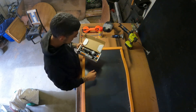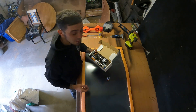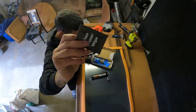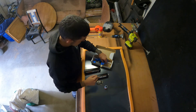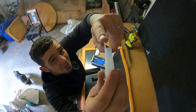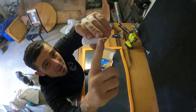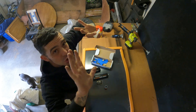A bonding kit. Now this window kit comes from Van Pimps as you'll see they're branded on there. I'm not paid or endorsed by them, it's just who we use and who we've got a trade account with. You've got your sealant, your glass wipes for prepping the surface, the primer that we apply to the glass, the applicator for the primer, some rubber gloves which I never use and always get it all over my hands, and the nozzle. You'll notice here that the nozzle has got a triangular shape cut out the back of it and a piece sticking up there, and that is to give you the depth of your bead. So you always have that triangle running away from the direction that you're going in and it'll leave a nice triangular pyramid shaped bead for you to squash down.